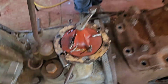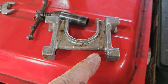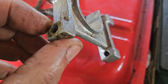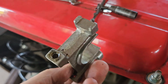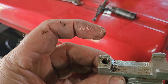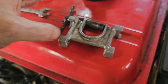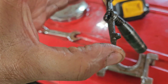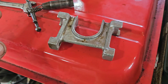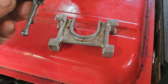We do have to pop the cover up enough to switch the linkages around. This piece here was something the engineers at Ferguson decided to add — it's an afterthought. Early models don't have it apparently, later models do. It's just as-cast, almost — they didn't do any machining, they just drilled and tapped it. What it does is: there are two big forks that hold onto this and it stops them from spreading and popping off. That was the mistake — this was laying in the bottom; it had popped right out.